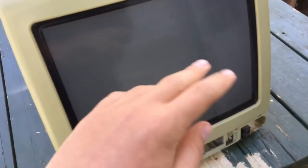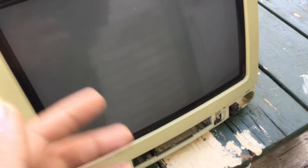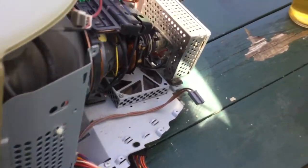A little bit of CRT safety precautions. If you do not know anything about these kinds of old screens, you should not even try taking it apart. These are very dangerous if you don't know what you're doing. There's high voltages in there — they could shock you really badly. So if you want to take these apart, it is a risk and you have to know what you're doing. If you do know what you're doing, it shouldn't be too dangerous if you take the right safety precautions.